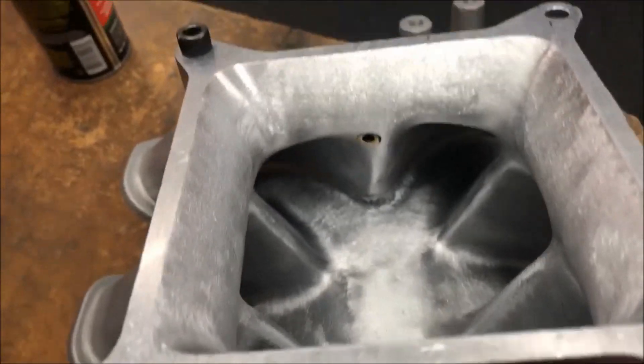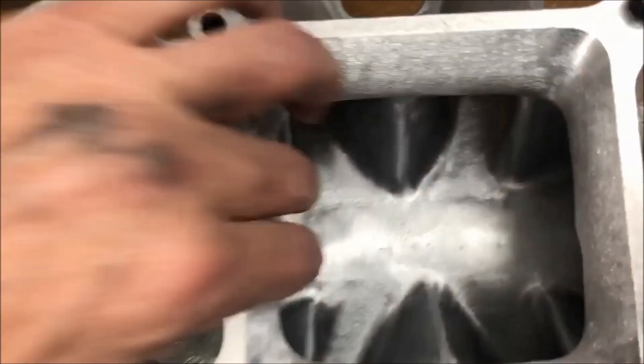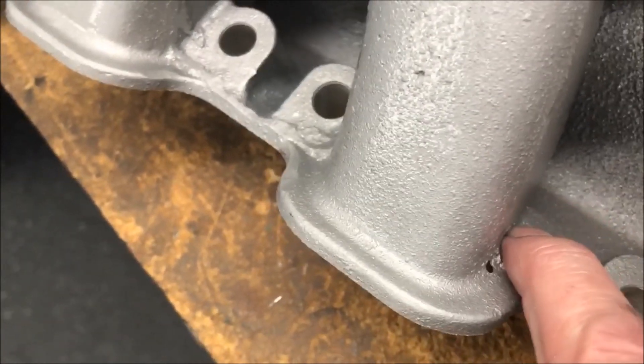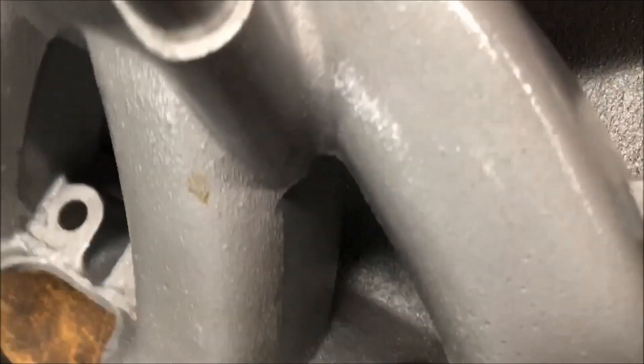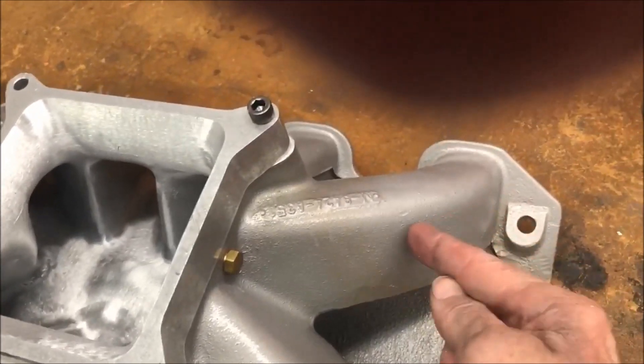Put the tops on. You can see it's real tight through here — it's wider this way, so the air wants to go to the outside runners. There's a little fin right there that needs a nice little epoxy in there, and out on this outer wall, this one right here — re-powder coat this thing and then it will be done. This wall right here is only 150 thousandths all the way up, so it needs something on the back.